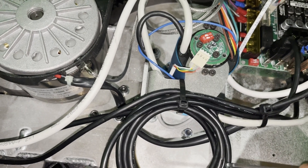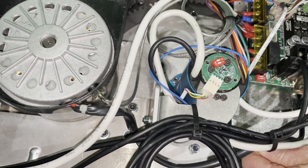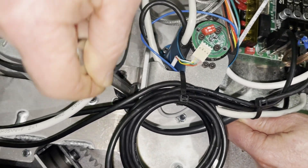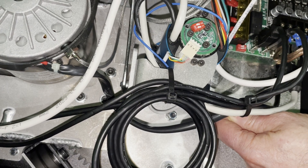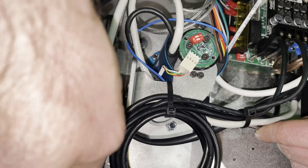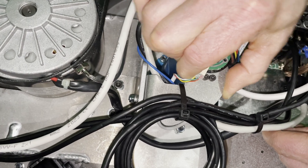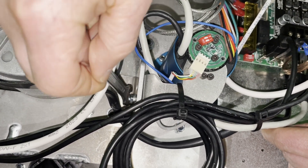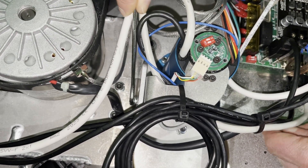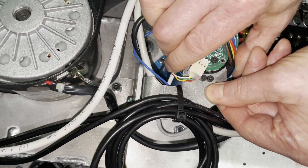Showing the washer there, and now I'm loosening the bottom one. It's expected that this will still stay connected because the nut is a nylock nut. Be sure not to undo it so far that the nylon part comes off the thread of the bolt, but loosen it enough that you can see movement between the two metal pieces — this allows the flexion to occur.